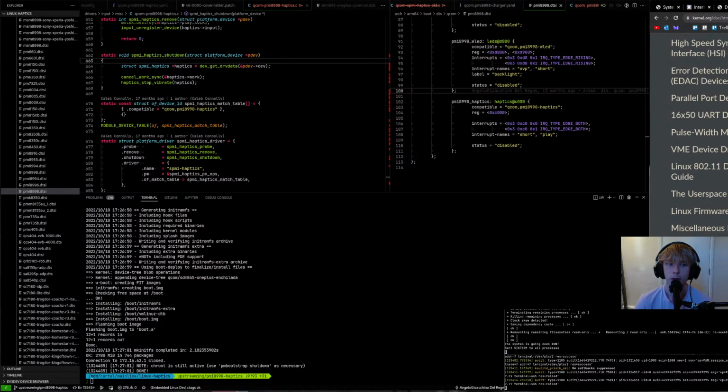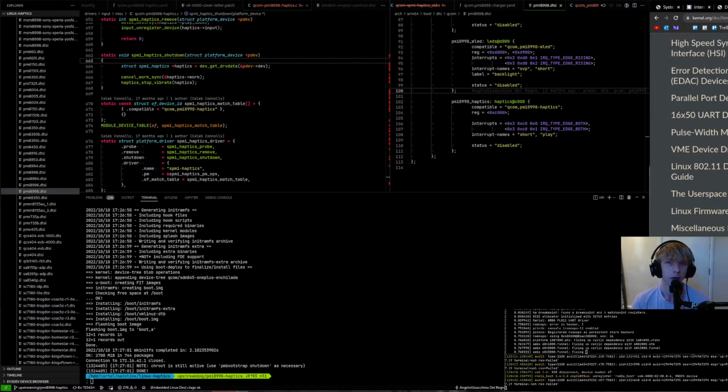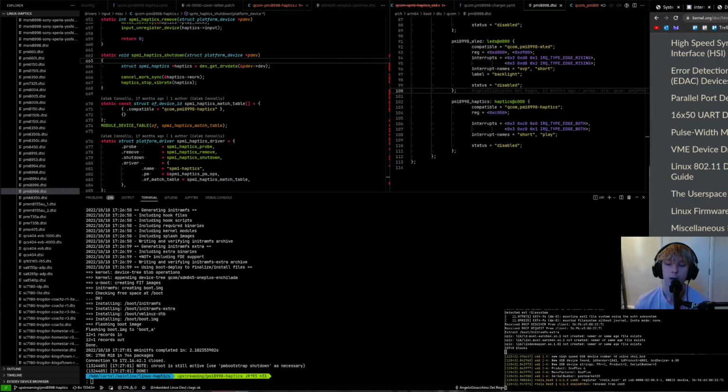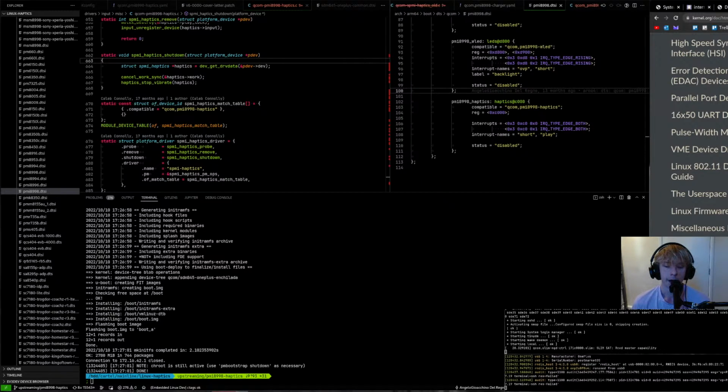Does the Pocophone F1 have a video mode panel? I thought it was command mode. Or, I guess it is video mode. Nice that you can overclock it at all, because you simply cannot overclock command mode panels. Or not usually, at least. Because of how they work.